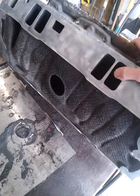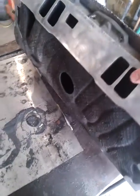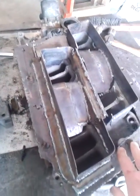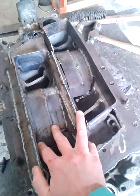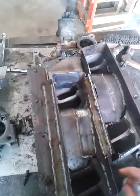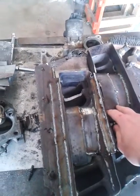I haven't port-matched the intake ports on the manifold yet — I've done the heads but I still have to match those with a gasket. I originally just had a big box design, but Terry said that probably wouldn't work because you need runners — that's how a normal intake manifold off a carburetor or TBI actually works, just runners that go to the port. So I took it back to the drawing board. These funnel pieces here — I haven't ground them down yet, just rough fitting — these would go to your ports.